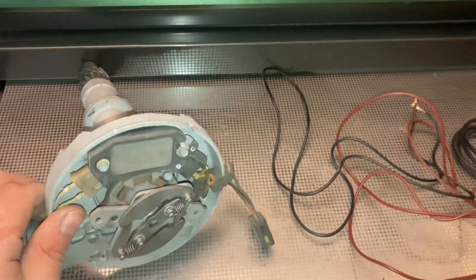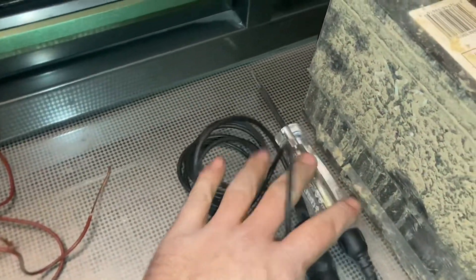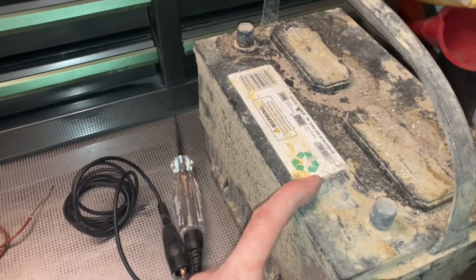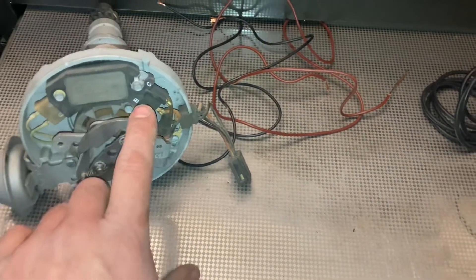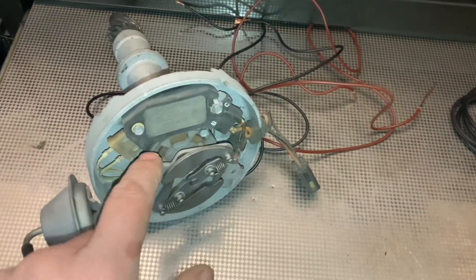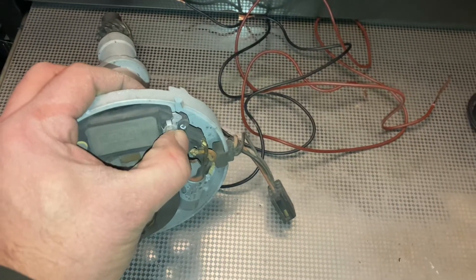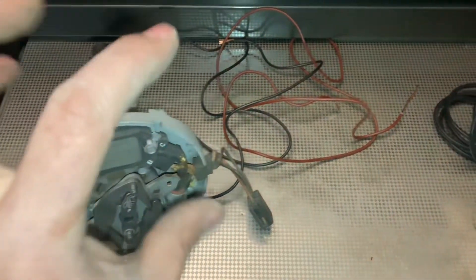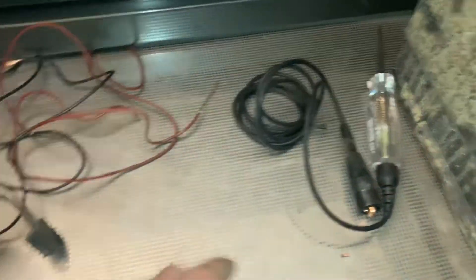To check out our distributor here — any condition of HEI — you're going to need a couple pieces of wire to wire it in, a 12-volt test light to act like our coil or the output, and a good battery showing 12.6 volts. What we've got to do is make sure this module is good, pickup coil is good, and that it will create a ground pulse to operate the coil. That's all the distributor truly is — a ground pulse generator. Battery voltage comes in, the pickup coil operates as it rotates, and this wire labeled C on the module is just a ground pulse. As the distributor turns, it creates a ground pulse if it's working right. We'll wire it up, use the test light, and watch it blink as long as all these components are good.